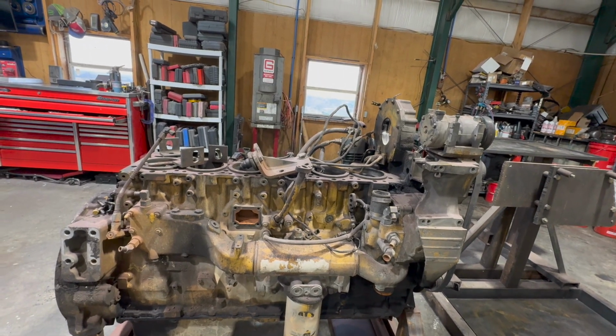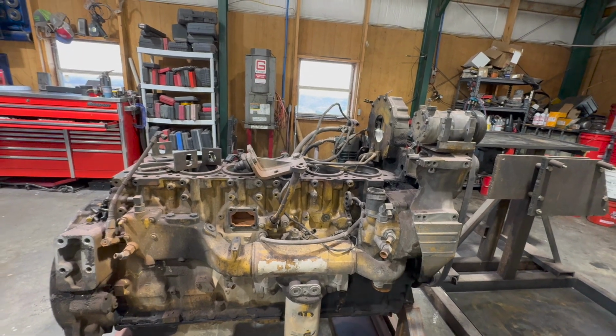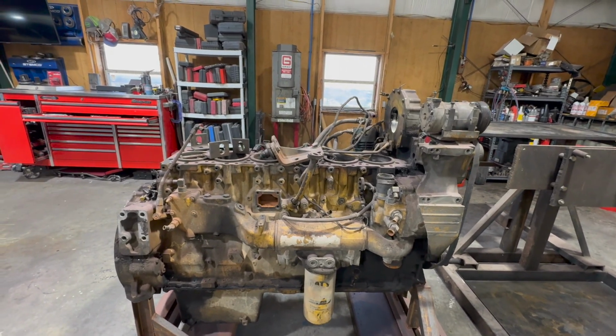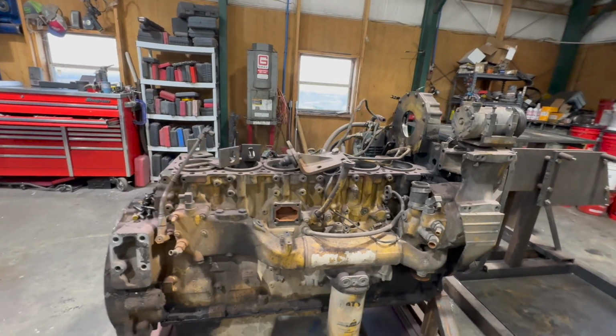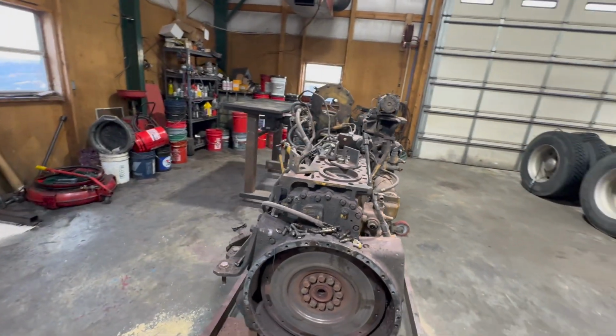And that is an issue when you delete the intake valve actuators out of these MXS engines, NXS engines, BXS engines as well. In order to properly delete the intake valve actuators, it needs to have the compression lowered. Regardless, this engine right here, we're fixing to rip it apart. I'll show you a time lapse, most likely, of taking this out.